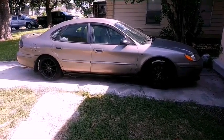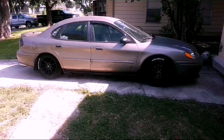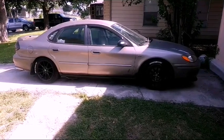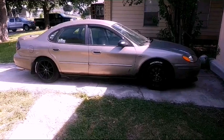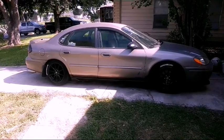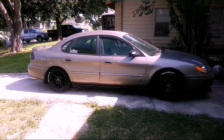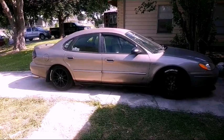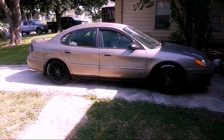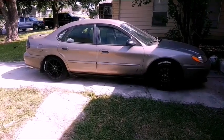Number three is suspension. Most of these cars when you get them are going to be worn out with miles on them, so the back end is sagging or the car sits like a 4x4. To fix that, I went with the cheapest fix: lowering springs and new struts. The lowering springs I have on the car are from King Springs — they lower the front and back one and a half inches. They're a progressive spring, so they stiffen up the harder you drive and the harder you corner. I think one and a half inches is more than enough for this kind of car since you still have to drive it daily.